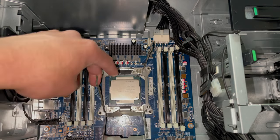Now this is where it really gets important. We're really going to want to put it to AHCI mode. We're going to want to make sure all our ports are enabled, or else it will not see your hard drive if you're using a SATA based hard drive or solid state drive. And you can go ahead and put eSATA on AHCI mode as well, and enable these. Although it doesn't really matter, we're just going to do it for troubleshooting's sake. Like I said, guys, just make sure your SATA controller is on AHCI mode and make sure they're all enabled, or else you're not going to be able to find your SSD in the macOS setup. So let's make sure everything's good here.